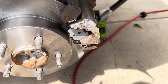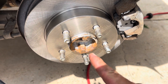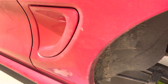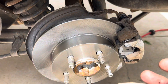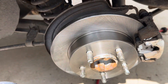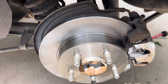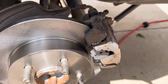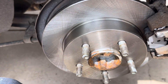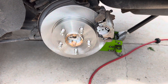Do the other side exactly the same way. When done, put the tires on, tighten the lug nuts in a star pattern, and torque them to 100 foot-pounds. Then go inside the vehicle and push the brake pedal to the floor a couple of times to make sure you've got a firm pedal — this takes up the gap between the piston and the pads. If you don't do this you won't have brakes. That's how you do your rear brake pads and rotors — if I helped you out, please subscribe. Thank you.